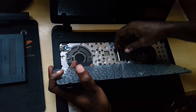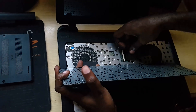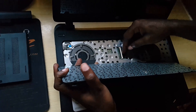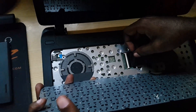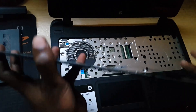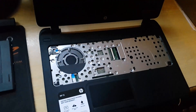There's a black tab. You're gonna push it upwards — use your finger to pry it up, vertically. It's gonna actually pop open. Most of these tabs have the black on this section, but for some reason this model has it on the opposite side. So always aim for the black tab and lift it up. Once you lift it up, the ribbon cable will be loose and you're gonna move it out. Make sure that you don't yank it up as it's in there very tightly. Flip it over without lifting it too high, then flip the tab up. Once this is removed, this is the keyboard — so if you are doing a keyboard replacement, this is where you'd actually replace it.